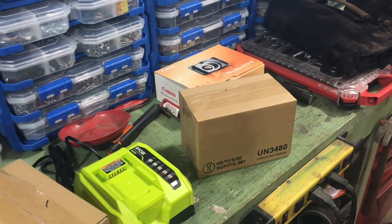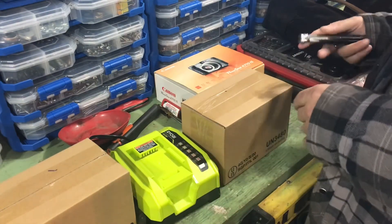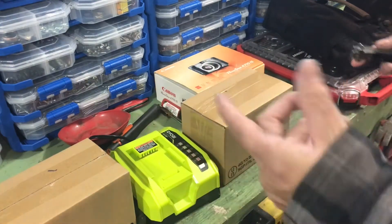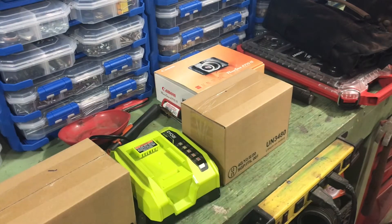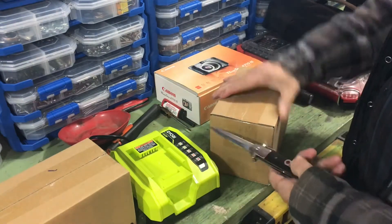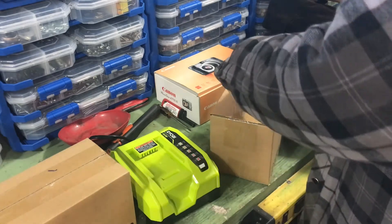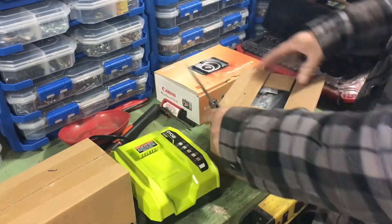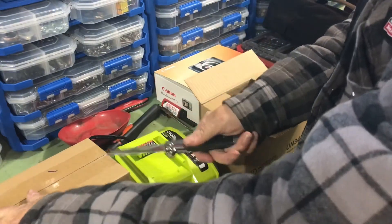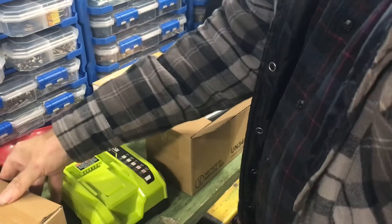I brought it home and tried it out — everything worked except the self-propelled feature. I ended up having to take it back and went with this one instead, because after reading more reviews it turns out the self-propelled feature on the single blade is basically faulty. I looked it up to see if I could fix it myself — flipped the mower over and the motor that propels it is actually just a little barbecue rotisserie assembly, the little black box the square rod goes in. That's what propels it, and obviously it's not strong enough to last. This mower has a completely different propulsion system, and I haven't heard of any problems with this one — though I found out about all the issues with the other one only after I bought it.